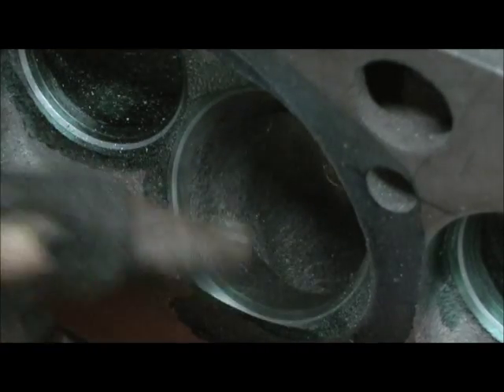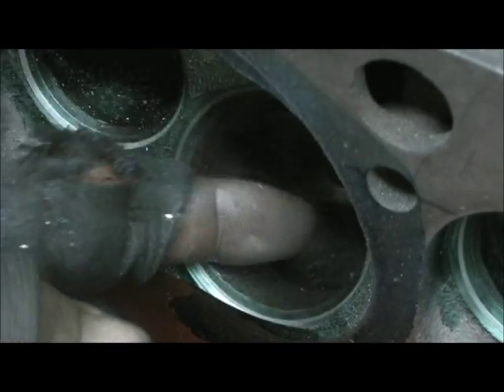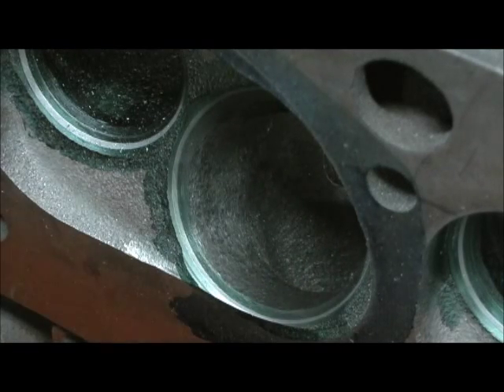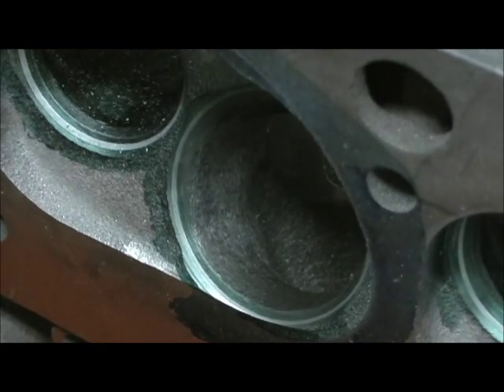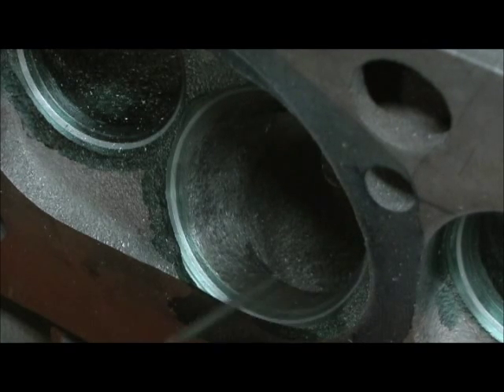Okay, I've about got that pulled as much as what I want. Remember how much overhang was there? I just chopped it all down and pulled it right into that ridge. Now, what I was telling you earlier about there's a way you're going to be able to tell — well, this is it. Notice the carbide cut marks where it brought it back shiny, where I blended it.